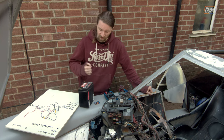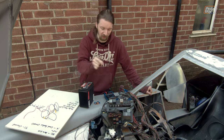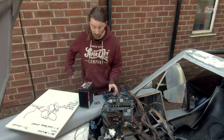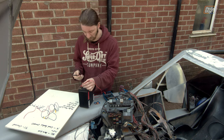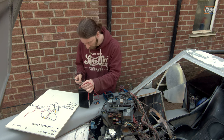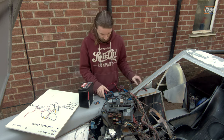To actually do these tests we're going to take our little Odyssey racing battery that's been sitting in the house for quite a while — decent chance it's flat. We're just going to feed it into each of those different little terminals. We checked the multimeter to make sure there are still a few volts in the battery since it's been sitting for more than a year. But we've actually got 12.7 volts in there, which is more than enough for this sort of testing — way more than we need.